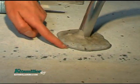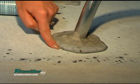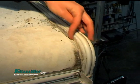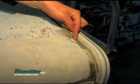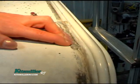Every place that the manufacturer has actually cut a hole — they're going to drop in vents and things like that — they use sealant to seal all the way around the vents, the sewer caps, the front and rear caps, anywhere there's a molding. Those are places that are going to shrink and contract, and those areas right there are what we're focusing on.